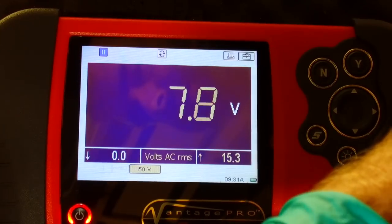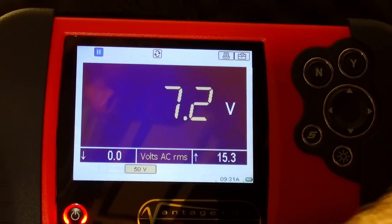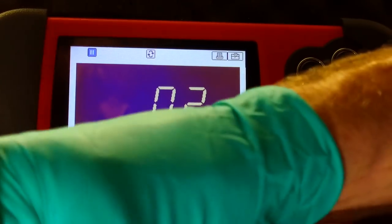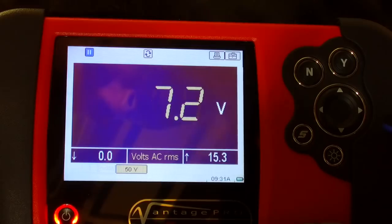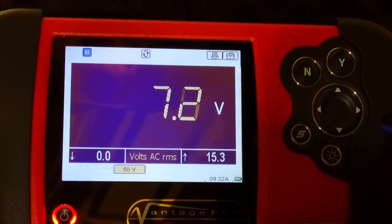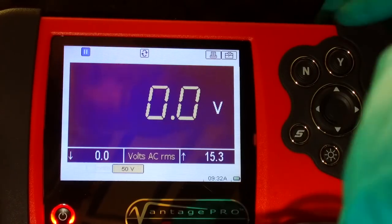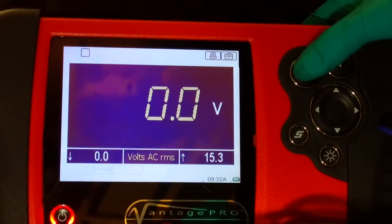7.4. So, as I said when the battery voltage was creeping slightly, we've got a duff phase in the generator. I'll just carry on with my test, so lead along and then do them again. Yeah, it's that one phase. That's alright. Okay, so we've got a duff phase from the generator. So I'll put the meter now to scope mode, and we'll have a look at the actual waveform, see what it looks like.